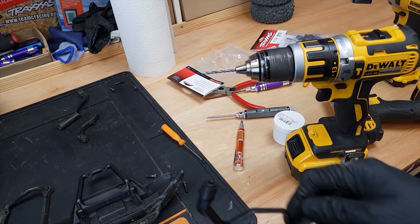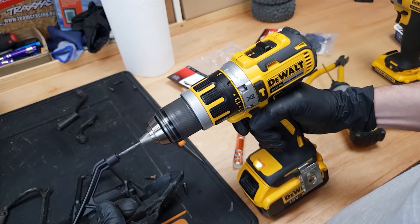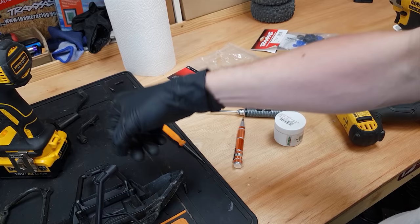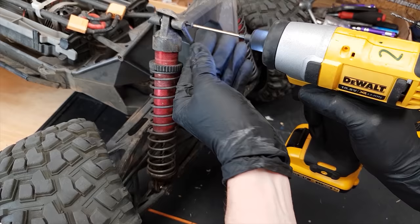This part here is actually quite a common place for screws to strip out of, so I like putting in longer screws. I'll find the drill bit that fits the existing hole and just drill through. Now we can put in longer screws, and even if that screw does pull out we could even put a nut and bolt through there eventually. Next, let's have a look at what's going on with this shock.